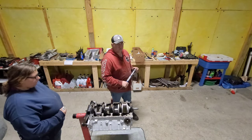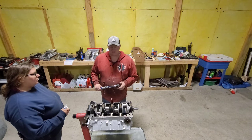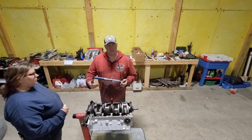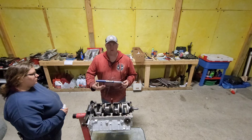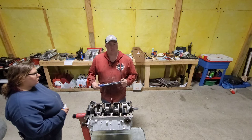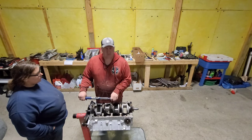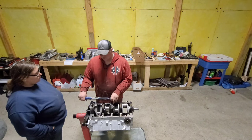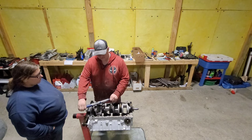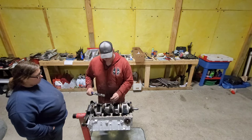So the main bolts get torqued down in three sequences. Some people say to do it one way, some people say to do it another way. The way we did it last time was 50, 75, 100. So I'm going to go ahead and do that again this time, because as I said, it worked last time. So I'm not really going to argue with something that worked. One thing I will say, the downfall about this is a 3/4 inch ratchet, 3/8 ratchet, and it is short. So you eat the Wheaties in the morning. There we go.